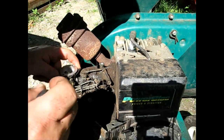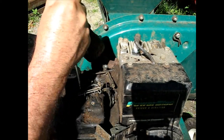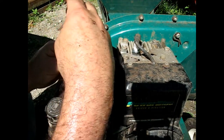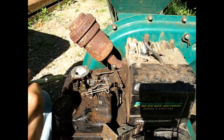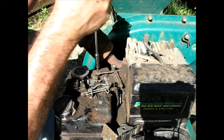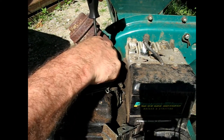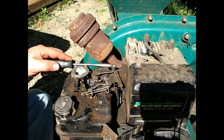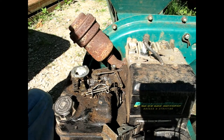How many screws does this carburetor have? There's another one under here — so this is the third. I'm going to switch over to Torx. This bolt goes all the way through the carb and out the bottom — it's that long. Now the ones at the block — those are hex and Torx. I'll go after this thing with the Torx T27, might be a T30, but it fits pretty nice. The other one I can't get with that tool, so I'm going to go with a 3/8 from the side.